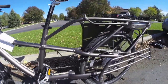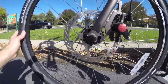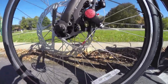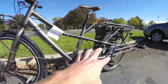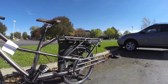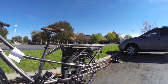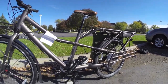Some other complaints: you'll notice back here there's a V-brake, whereas in the front you've got a disc brake — I think it's a BB-5, looks like maybe 160 millimeter, and it's mechanical, so there's a little bit of inconsistency in the braking. I like that you've got a fender up front, but there's no fender in the back — water is mostly covered from that rack, but it'd be nice to keep the battery a little bit cleaner. The battery doesn't come on and off very easily, either.